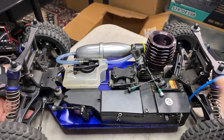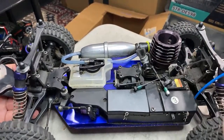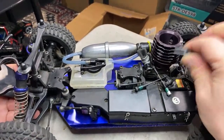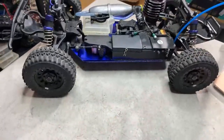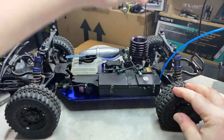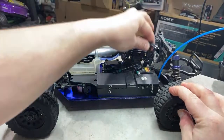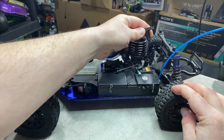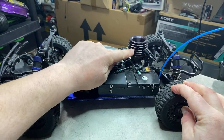Let's see what happens if I pull this cord. Oh — that's bad news right there. So far we got nothing. These systems don't actually mean it's dead — these use a coil off-crank pulse starter, similar to the HPI system. The throttle return spring is still there, that's a nice touch. A lot of this stuff is plastic — these were kind of low-entry RTR models. A regular Slayer would destroy this; the Slayer is light years ahead.